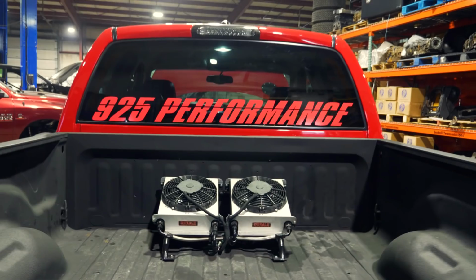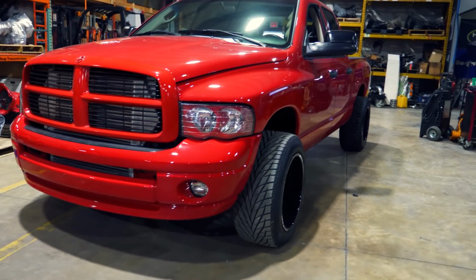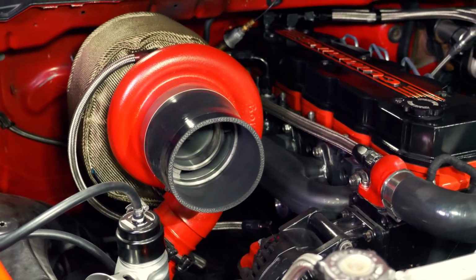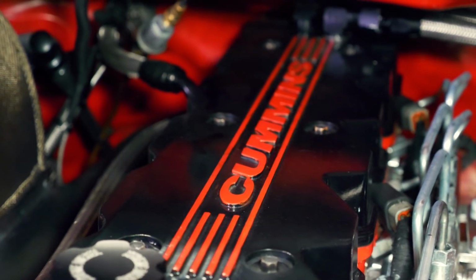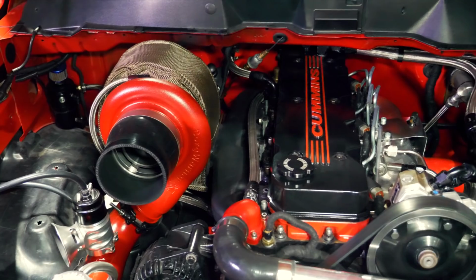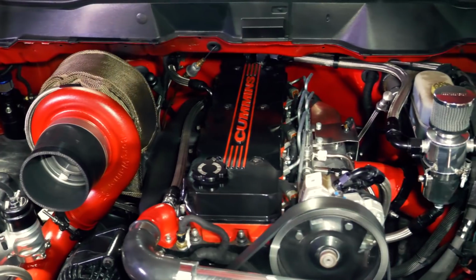Okay, today we've got Josh Ewing's '05 Dodge on the dyno, and I'm going to let him tell you guys a little bit about what's done to the truck. Why don't you tell him a little bit: injectors, fuel system, engine. Yep. It was a factory 5.9 truck. We did a 6.7 swap, 300% S&S's, 212 mil pumps, stock bore QSBs. It's got Wagler Street Fighter rods in it.